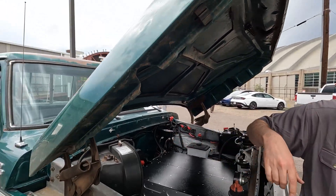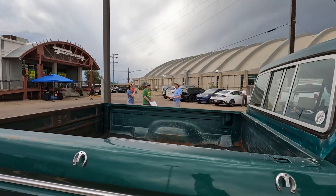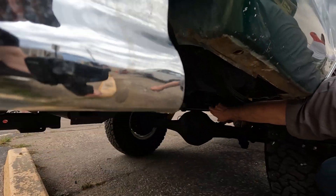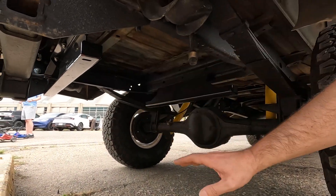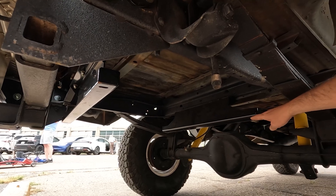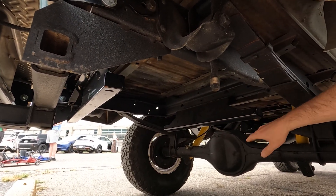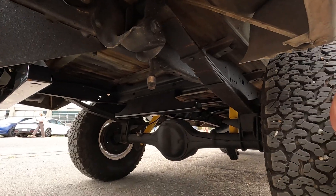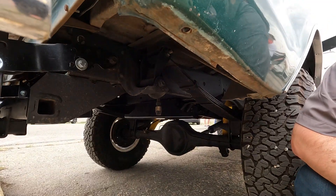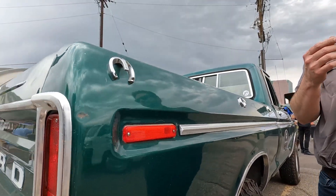We also have room for a second pack in the rear. You tuck under the rear a bit and you can see the brackets — between here and here, a whole other 30 kilowatt-hour system tucks in nice and tight, right up against the frame. You can't even see it when it's in. That doubles your range and helps maintain voltage for a longer amount of time. And since they're Tesla modules, they're already built for liquid cooling, so it can be easily plumbed.